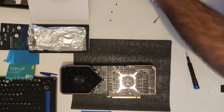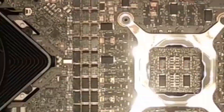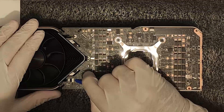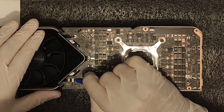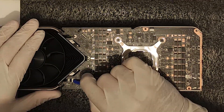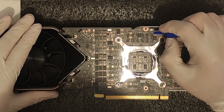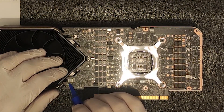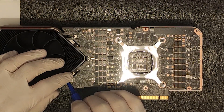Next, turn your attention to the cables before proceeding any further. There are two ribbon cables and one small proprietary LED cable. Start with the ribbon cables as those are easy: just lift the gate with your finger or the plastic pry tool and gently remove the cable from its enclosure. If you feel resistance, don't just tug — make sure it is centered when coming out, and don't forget to lift the gate or you might damage the cable.